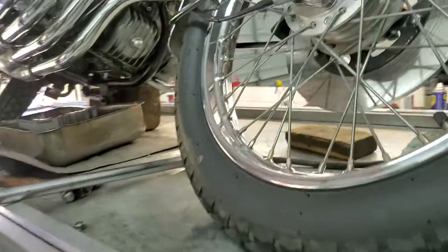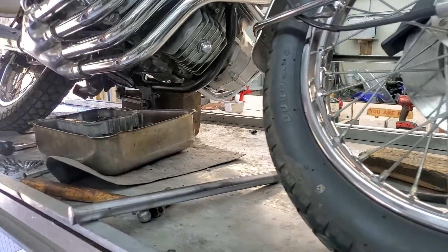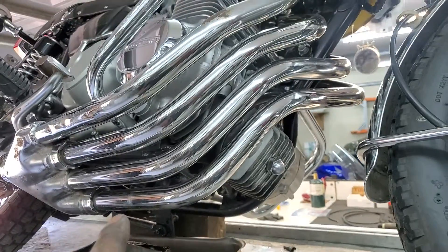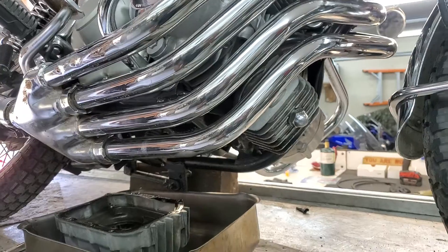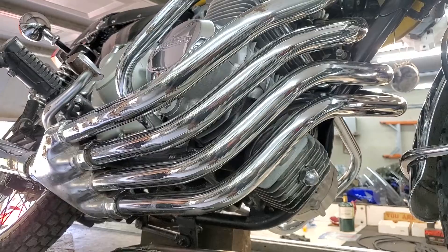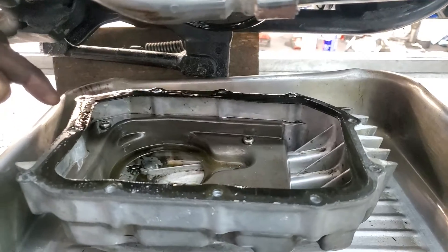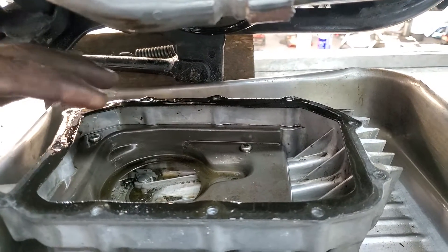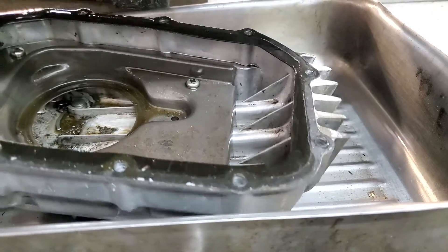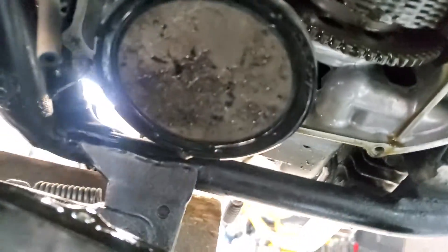Okay Evan, potentially some bad news — but first the good news: I got the oil pan off without removing the exhaust, which means you've now got 10 exhaust gaskets you can enjoy. The oil pan gasket came off intact — clean, super nice. This makes the whole process very fast and very easy. But here is the major deterrent, my friend — let's just check that pickup straw.